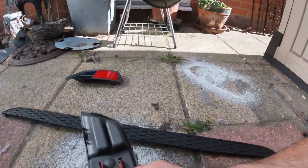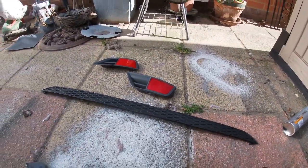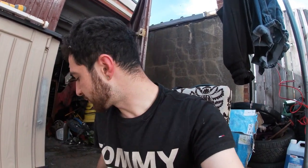I don't want to do the grills probably until Friday - obviously you've got to take the front bumper off for that, and I've got a splitter so it's a bit more of a pain and there's more sanding. So we'll be doing those in a few days time. All I'm going to do is pop the tabs out of the reflectors to remove those, then I'm going to key these up starting with a light sand on 400 grit, then moving to 600, wiping them off, and then spraying them with some plastic primer.